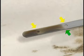If the oil level is anywhere between the upper level mark and the lower level mark, as seen in this case, the oil level is okay. Oil level should not be below the lower level mark, but it should also not be higher than the upper level mark. Be careful not to put in too much oil when filling up.